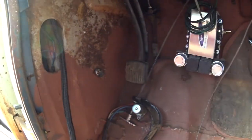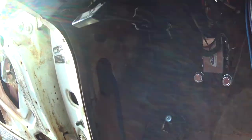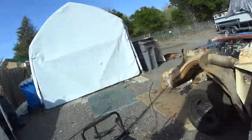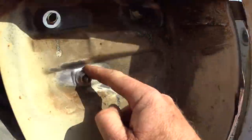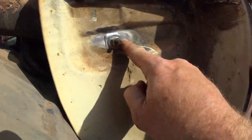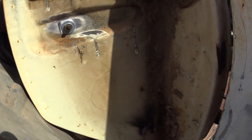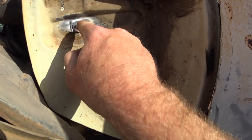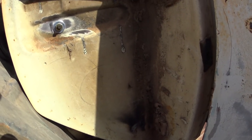Okay so here's what it looks like on the inside. These were the three bolts - there's one up there, one here, and one over here - that I was tightening while holding the nuts on the outside. You can see the emergency brake works, the release works, so we're happy with that. Now we've got these nuts in place on the bolts, we're gonna tack weld these in here so they won't move again, and if we do need to remove that bracket, these bolts will still come out.